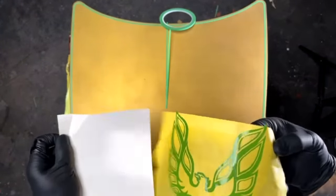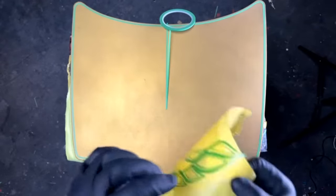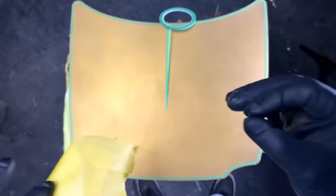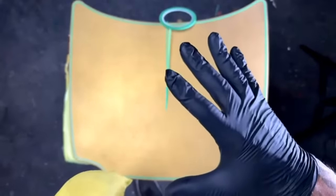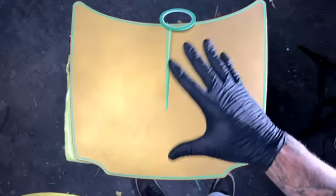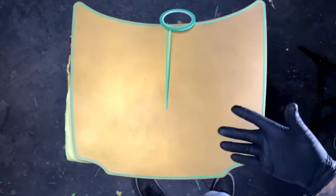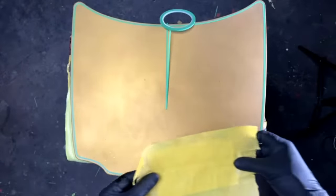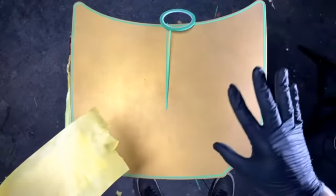Can you mix a pearl base pigment in with your final clear coat? Yeah, you can do that. Well, I don't know if it's best to do your final clear coat, but just remember when you're putting pigment or anything into a clear coat, it lays down and it kind of levels out. So if you run it, you're going to run that pearl too. And once the pearl runs, you can see what's going on, so you're not going to be able to hide that. So just keep that in mind. If you're going to do it, be liberal with it just a little bit.